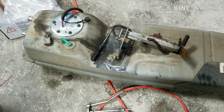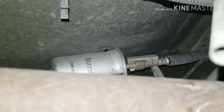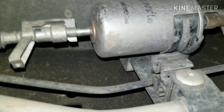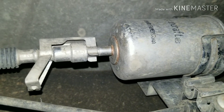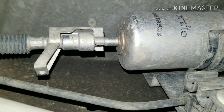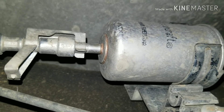Go ahead and put the new pump back in, being careful of the sending unit. Now, before doing anything else, I want to change this fuel filter — you can make out it's a Motorcraft filter, which usually means it's been on there since the factory or a dealership service. Just take this clip off here and this clip off there. The main reason a fuel pump goes bad is either you ran it too low on gas too long, causing it to overheat, or the fuel filter is plugged. If this is the original filter from the factory, there's a lot of extra pressure the pump has to push against, causing it to fail sooner. Changing it is just like putting new socks in new boots — you don't want old gross socks in brand new boots.